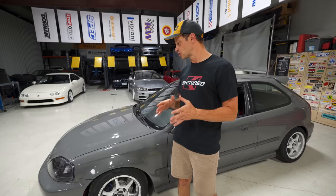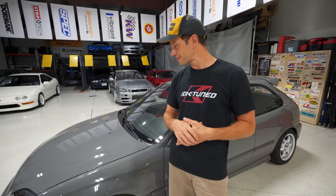We are not going to do a limited slip differential. I would love to do that, but from a scope of timing it's just not going to happen. It's a lot of work to put a proper limited slip into a gearbox — it has to come apart, be shimmed, done properly, and put back together. But I'm confident with the other mods we're going to do, this thing will be a much better driving experience. So let's get started.